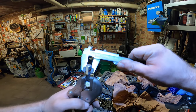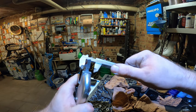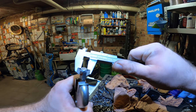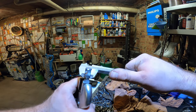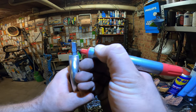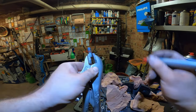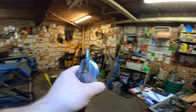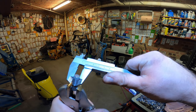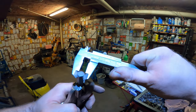So we only did one tenth of a millimeter here. This is 9.3, something like that, but only the top, not the bottom. So on this side we need the bottom and the opposite side as well, and do one thing at a time. So I'm doing two, but yeah, whatever. So yeah, let's go. 9 and a bit, 9, a bit less than 9, and a bit less than 9, and 9 and a bit.